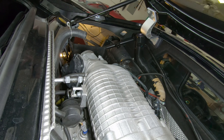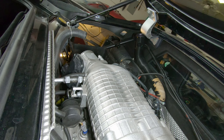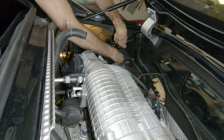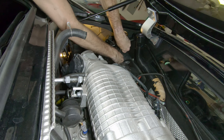According to the picture — we get this off, the bag of chips will come off and it'll make more room. According to the instructions, they're just like, yeah, just pull it out. I guess that bag of chips is the U bypass duct. It does say remove one end of the U bypass duct, making the air box easier to remove.